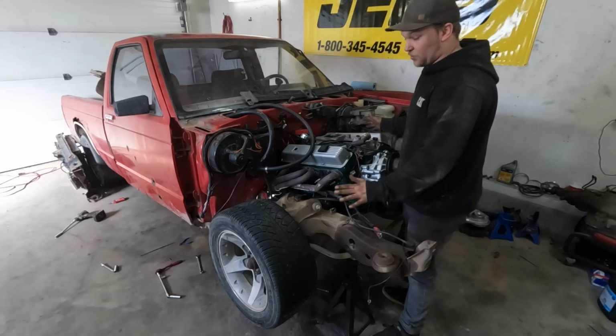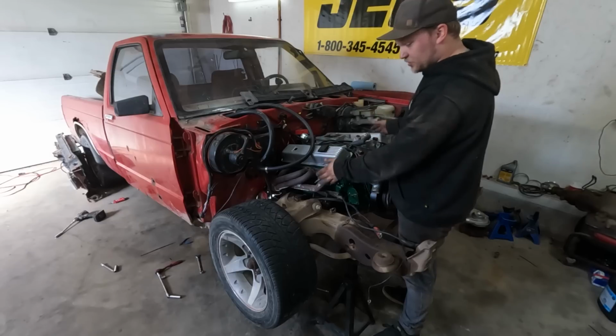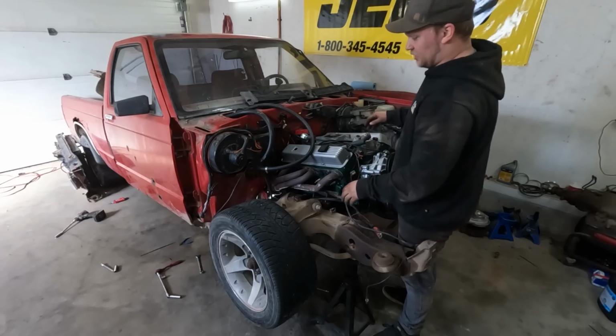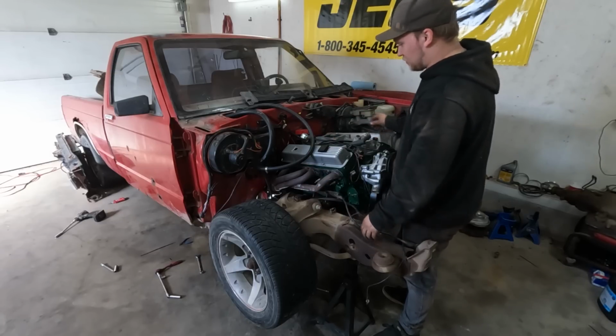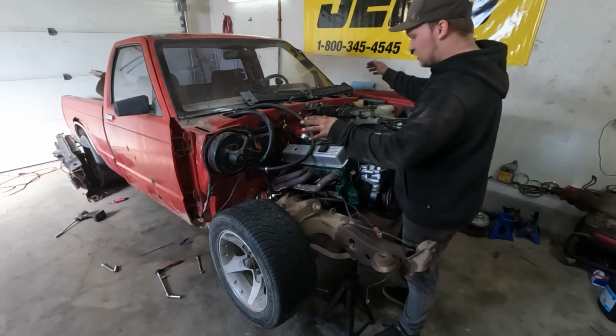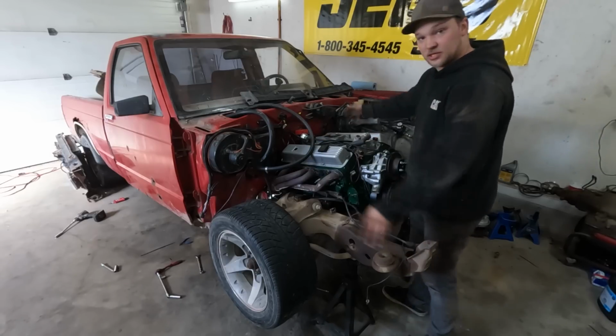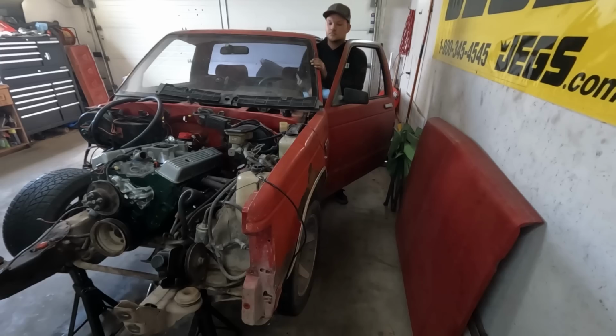Okay, I haven't really been recording any of it, but I've been rolling around on the floor for the past couple of hours. I got the exhaust bolted on completely, collectors and everything. That was a bit of a mess. Some stuff shifted and I was just swearing at it forever. Drive shaft is in, transmission cross member's in, all that stuff is good to go. The last piece I need to do is bleed the clutch, and then we can put Farmy back on the ground and get to the front of the engine.